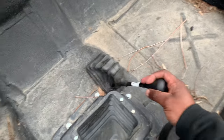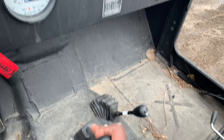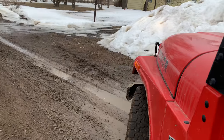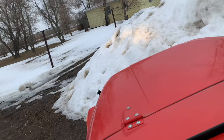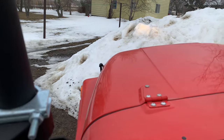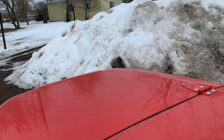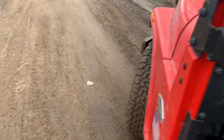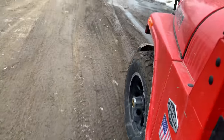A word of caution: this being a manual four-wheel drive, not everything is electronically controlled. You might have to play with those shifters a little bit until you break them in — maybe after a thousand to two thousand miles of shifting, especially for the four-wheel drive and two-wheel drive selector. That will help everything shift smoother, as the gears are quite tight coming out of the factory.